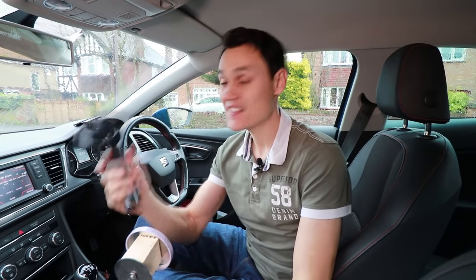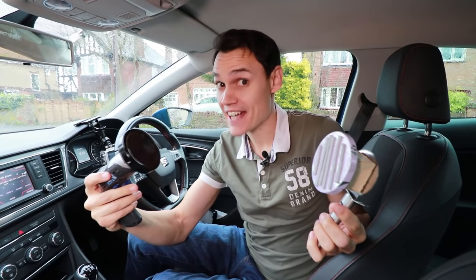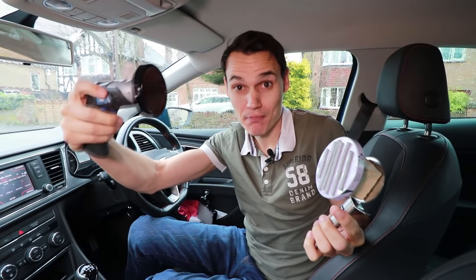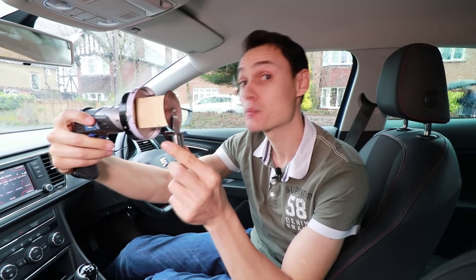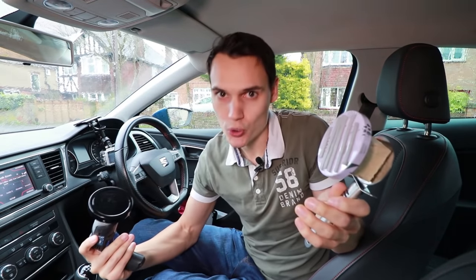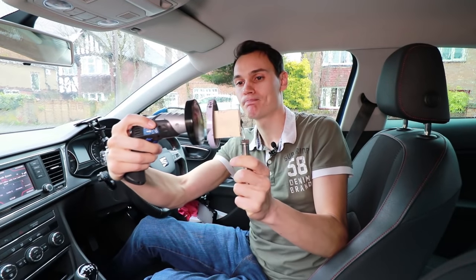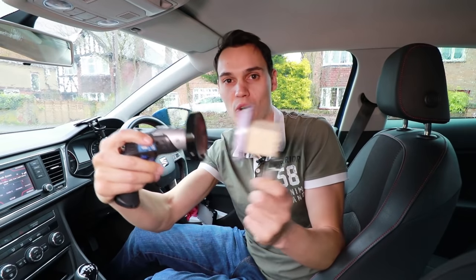I've mocked up a pizza slicer and an electronic screwdriver to try and explain what's happening. The electronic screwdriver represents your engine, and your engine even when it's just switched on and you're not adding gas is probably spinning about 10 to 12 times a second. When you lift the clutch up you're connecting it to the engine, and the clutch is spinning at zero times a second. You can understand why there'll be some shock as you connect them together, particularly if you clamp them together fully by coming off the clutch too much. You actually want a little bit of slippage so that the clutch, which goes to your wheels, can gradually catch up with your engine.